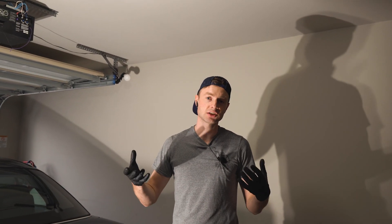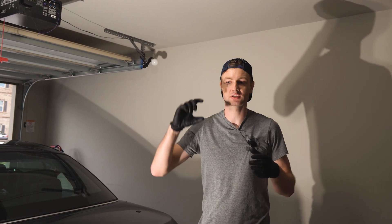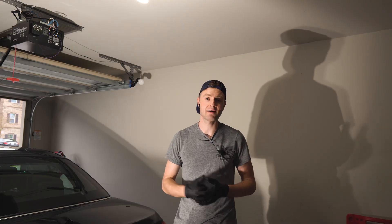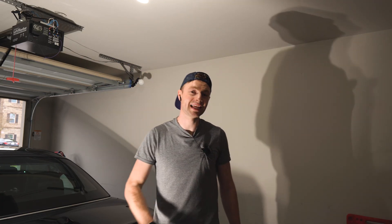The assembly has two motors, one on each side at the latches. The latches are manual but the motor pulls them up just a little bit to push the lid down. The micro switches are the 80% chance of your problem. The third and most expensive issue is going to be the motors themselves. Enough talking - let's jump in the trunk and see what's going on.